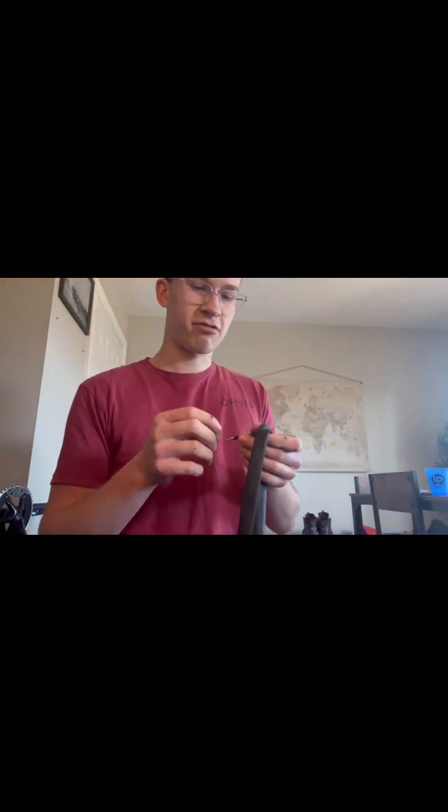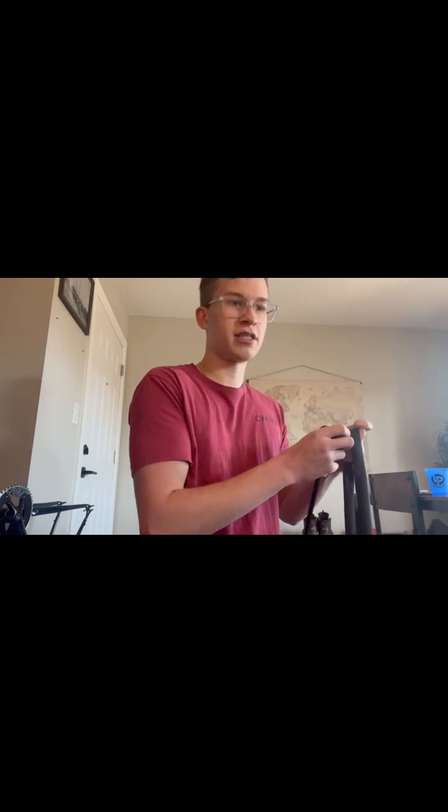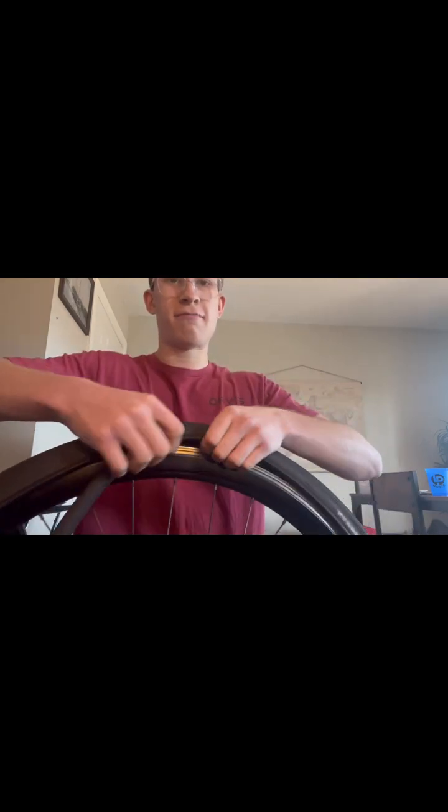Alright, so next is going to be kind of reinstalling that tire. So a little trick here, you'll take your floor pump or whatever means of inflating you have. If you're using a CO2, I wouldn't do this. I would probably try to blow it up with my mouth. But you're just going to put just like one pump of air, like not much in it at all, just enough to get it kind of inflated a little bit. And what that does is it helps it from getting pinched while we're reinstalling. So you're going to take the valve stem, stick it back down in the valve hole, take your tube, and just kind of push it up in the tire as you go all the way around.